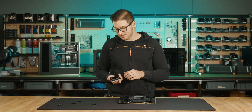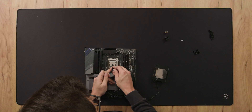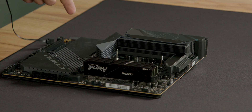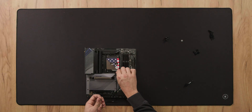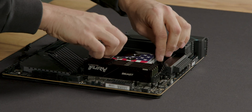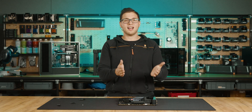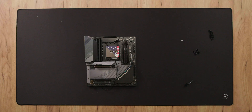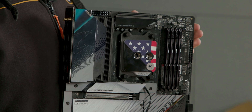Now that we've installed the new washers, make sure your water block is clean, apply some thermal paste — just a tiny bit — and put on the water block. Use all four springs and attach the thumb nuts. And voila! Your Quantum Velocity CPU water block is perfectly compatible with the AM5 motherboard, and it's ready to take the heat your CPU throws at it.